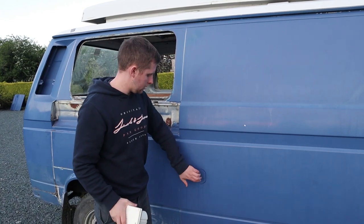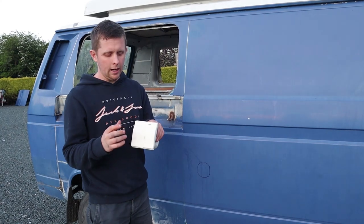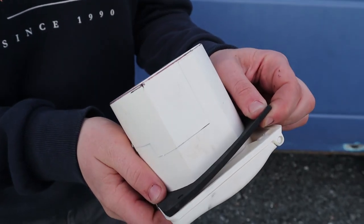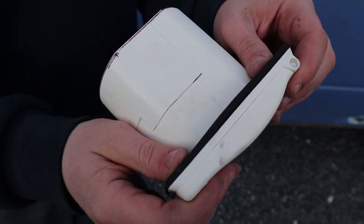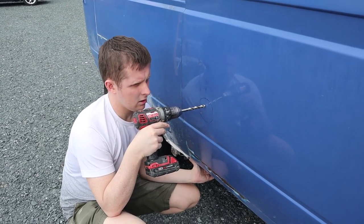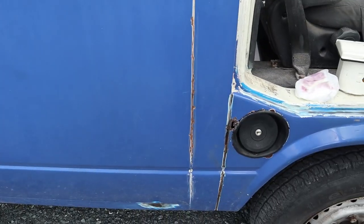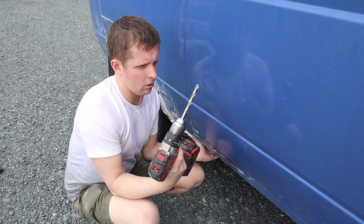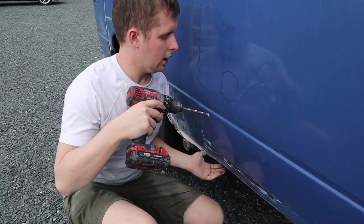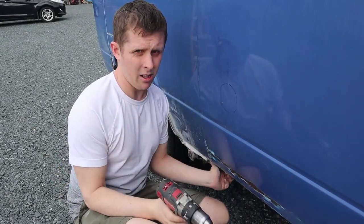So I'm just going to cut this bit out here with the angle grinder, and then once that's cut out, this here will slide straight in and then we'll screw it into place. It actually comes with a foam seal around it so when it is screwed in it'll be watertight. We've got the final location for our socket, so we've kind of lined it up with the fuel cap. First of all I'm just going to drill a hole out with a steel bit and then I'm going to use the jigsaw and cut around the shape, and then the plug will slide right in.